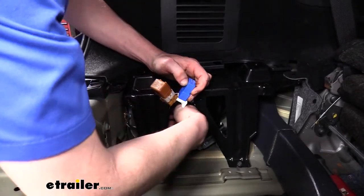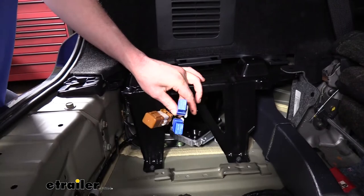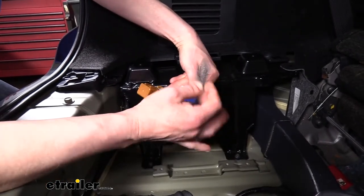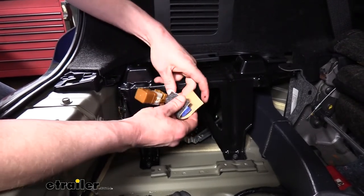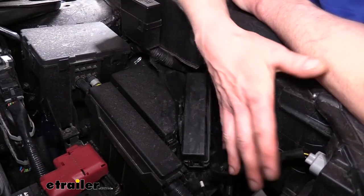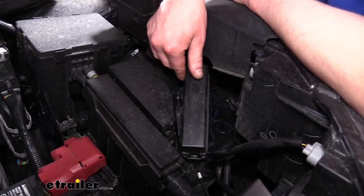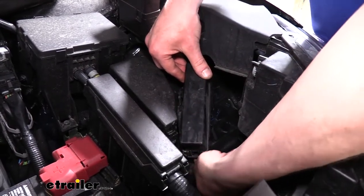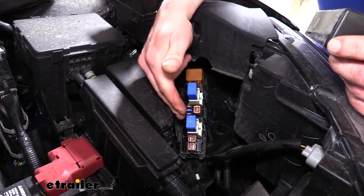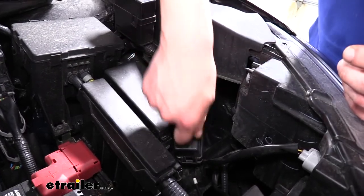The relays are only going to fit into their appropriate connector, so you really can't get it wrong — just line up your pins. The kit also comes with foam pads: peel off the backing and wrap them around each relay to help prevent rattles and keep them together. We're now underneath the hood on the driver's side, just behind the headlight assembly. The battery is right here, and just to the outside is the relay box — the small rectangular one is what we're looking for. Pull out on the release tab at the bottom to slide the cover off. If relays are already pre-installed from the factory, you're good to go and can clip the cover back on. If not, install the relays included with your kit.